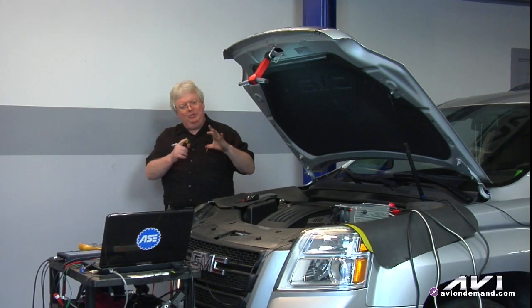I had to power down the high voltage system in order to take the top of the inverter cover off, which was preventing me from getting access to the ABS hydraulic modulator assembly. That thing that looks like the main brain for the ABS is not the main brain — the main brain is the skid control unit, the little module under the dash.